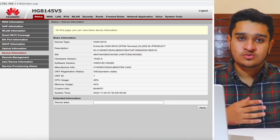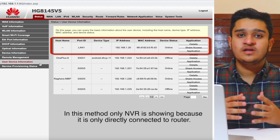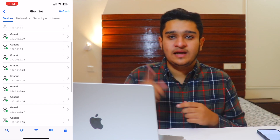To start off, you need the IP address of your camera so we can build an RTSP address to connect to it. Getting the IP address is simple — there are two or three methods. First, go to your router's configuration page and find the connected device list. Second, use an IP address finder app from the App Store or Play Store.